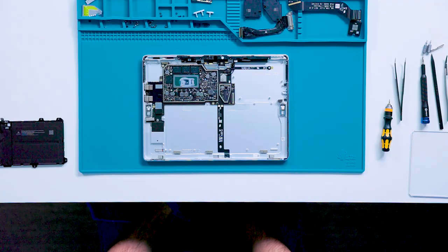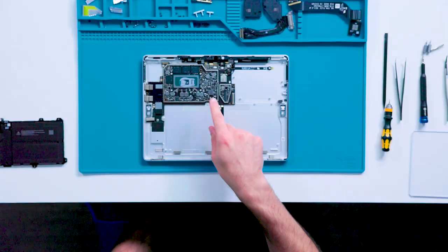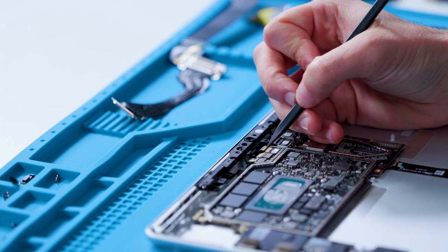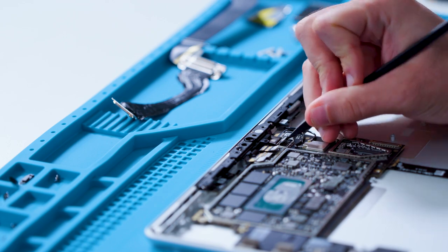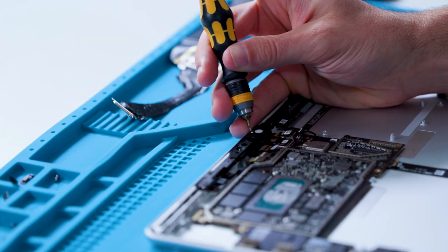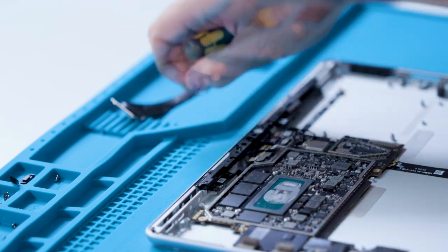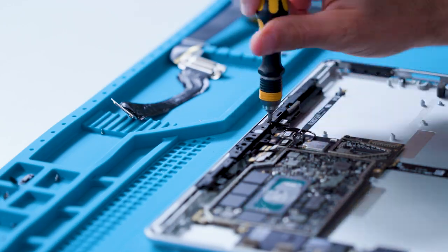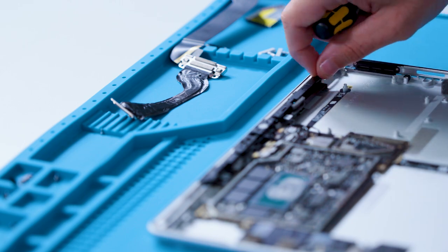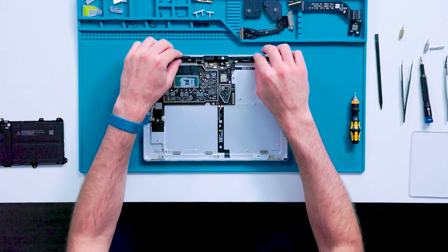We will then remove the Wi-Fi and sensor deck. Remove the shield lids from the motherboard to expose the sensor FPCs, using a spudger for this. We'll disconnect the remaining seven cables from the motherboard, which correspond to the Wi-Fi antennas, cameras, and microphone. We'll remove a total of six screws: the first two in the center region will use a 3IP, and the last four will use a 5IP. The two coaxial cables also need to be disengaged from their routing hooks. After the screws have been removed, the Wi-Fi and sensor deck can be removed from the device.